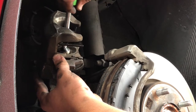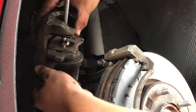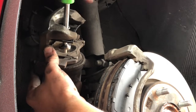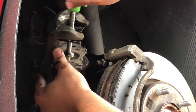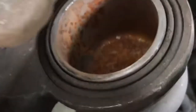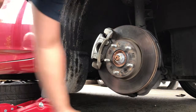Make sure the compressor is all the way down so you can fit it right in there. Then what you want to do is start tightening it — this thing's got to go all the way in. Go ahead and start twisting. There we go. Now that we have that done, you can see the piston is now back — it's not pushed out. So you can easily go ahead and put the caliper back in place. Make sure it's lined up, same with the back one.